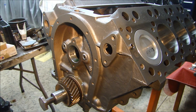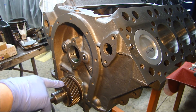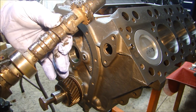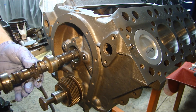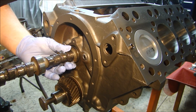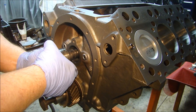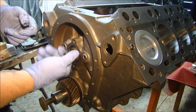Now I'm ready to slide the cam in. I start with piston number one at top dead center. It's pretty easy to tell when you're at top dead center because the timing marks on the front gear are pointing straight up — both of them are right at 12 o'clock. I have my bearings all lubed all the way through. And since I'm reusing the cam, I did put some assembly lube on all the lobes to make sure there's lube on them for startup. Being very careful not to drag it on each bearing, you can slide this right in straight. And there's the cam installed.